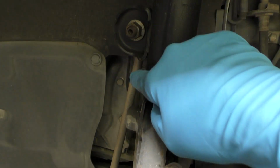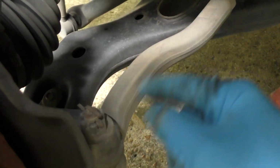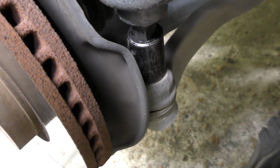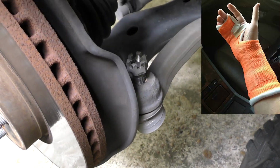car. Unbolting the torsion bar bolt here, taking these two big bolts off, and of course we have to remove the tie rod arm first so we can get working room, and then when we flip it to the side it'll come off evenly. So we get snippers and we put them on a cotter pin and pull it out. Then we remove the bolt on top of the other arm. I'm lazy, I'm using an air wrench. It's a lot easier than doing it by hand.